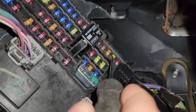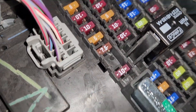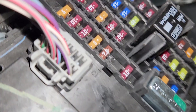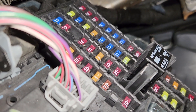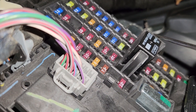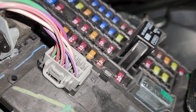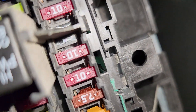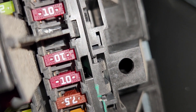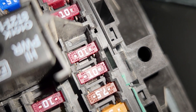Fuse number 9 is the second fuse you want to check. It's going to be just behind this relay. Fuse number 9 is a 10 amp red fuse — counting from the top, from 1 to 9, it's going to be right there. This is the red 10 amp fuse number 9, and it is the fuse responsible for power to the radio screen.